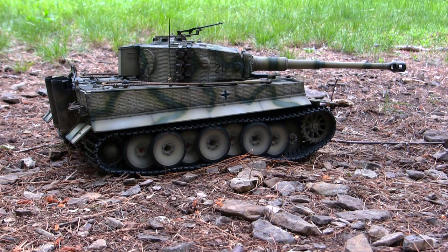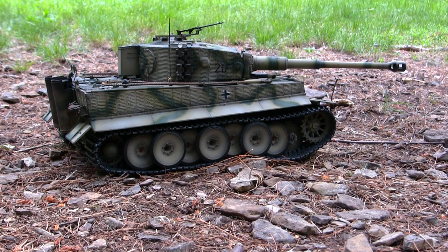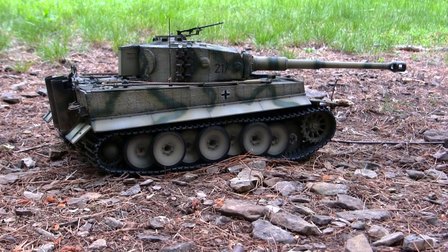I believe some of the credit for the tank being able to run pretty well on the off-road scenes that I just mentioned had to partially do with the vehicle's track modification. Like I said in the other two videos, the tracks that you see on this model here are not the stock Tamiya units. Those were replaced with a set of metal aftermarket tracks from Taigen. Taigen tracks, because they are made from metal, do give the model a lot more weight compared to the original individual workable link nylon tracks that were found on these kits.